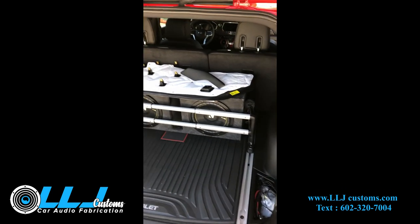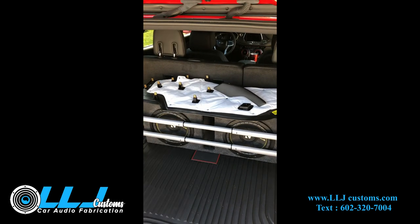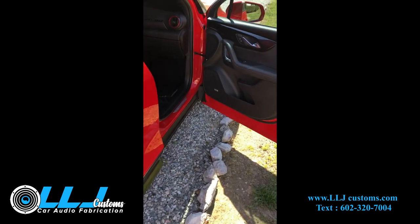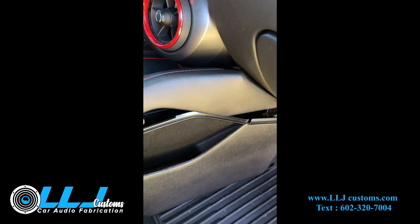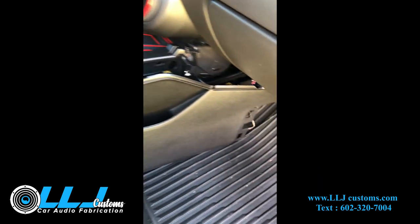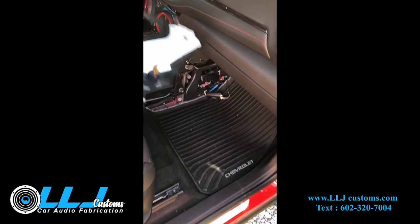On the side, basically I take off each side. What you're seeing back here is the driver side I already took off. There are two pieces — you pop off this little piece here, it's only got two clips. Pop it off down here and you've got a seven millimeter screw. Once you take that off you just got to pull hard because there are 11 clips on the back of this.